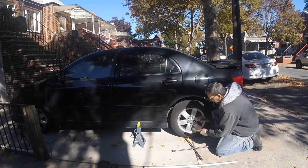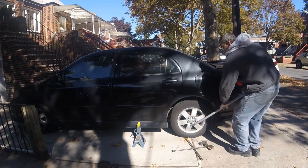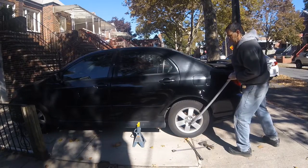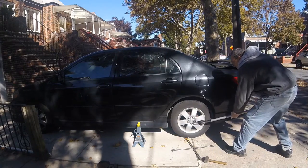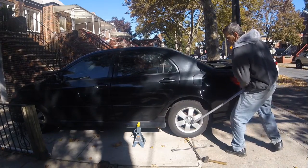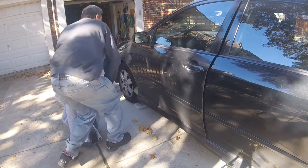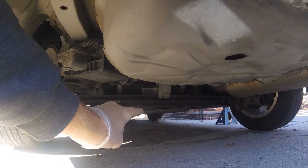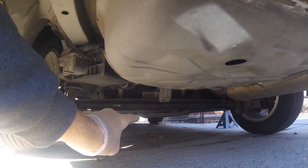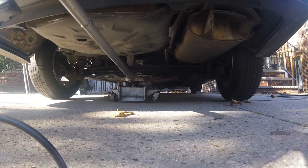Take sure you tap this on the breaker bar gently. Chock the wheels. Set up for jack location where these two holes are — locate on the car the center jack point, that piece that sticks down on the chassis frame. Lift the car after both wheels' lug nuts are loose.